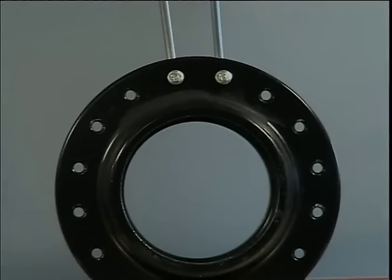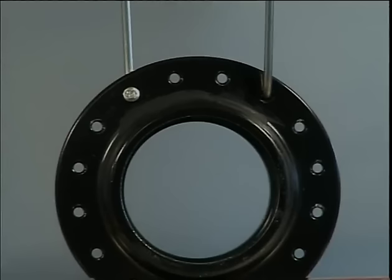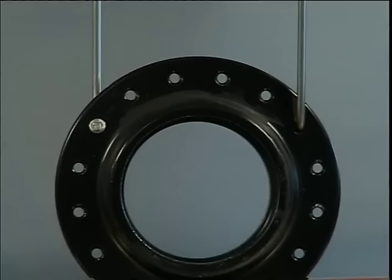In radial spoking, use holes 1 and 2. Both spoke heads outwards. When crossing once, use holes 1 and 4. Left spoke with the head outwards, right spoke with the head inwards. Crossing twice, holes 1 and 6. Left spoke head outwards, right spoke head inwards.